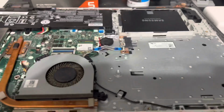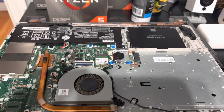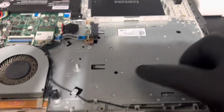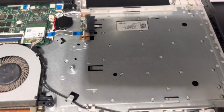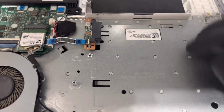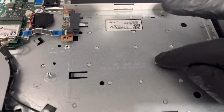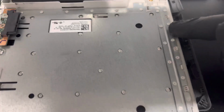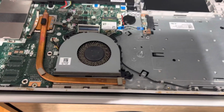The problem therein being that the way this system is built, that keyboard is actually mounted directly into the top panel, or what we call the palm rest. And you'll notice here, all of these plastic points you see here, these are all plastic rivets. Rather than using metal rivets to save on space and cost, what happens is all of these rivets come through and then they're just melted down, they're stamped. And so we actually have to pop all of these rivets to release the plate and pull the motherboard in order to replace the keyboard.